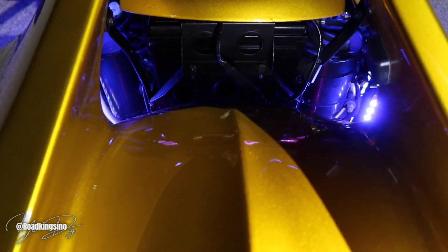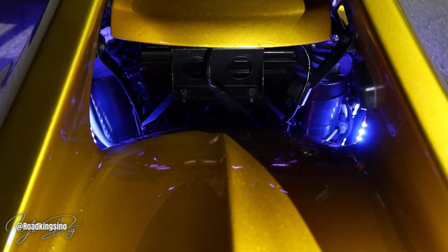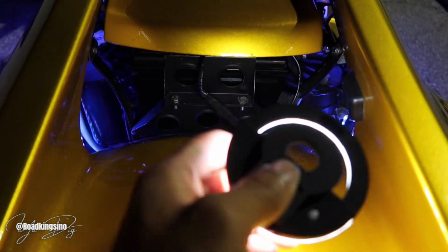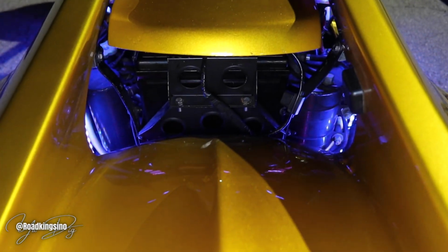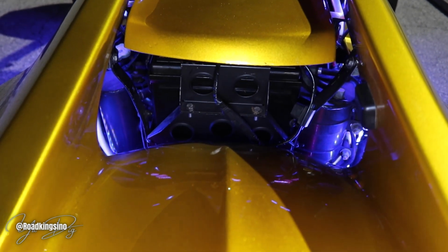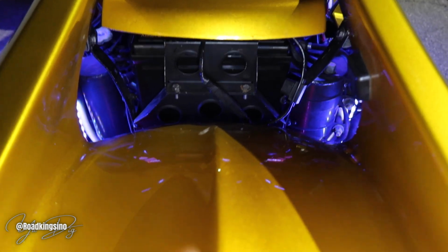This particular battery tray fits the yellow top without any problems. The dimensions on this, and you have to revert back to the video before this, are width-wise. Length, we're gonna say going this way. Width-wise was actually smaller with this battery, but I did have to push it down into the tray a bit because of those little clamp pieces. When you have a regular battery, let's say installing into a car, it has a little boot that clips around the lip of these batteries, and that lip part seems a little wider than the yellow top. No biggie, I was able to get it down in there.